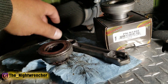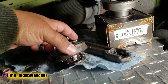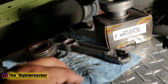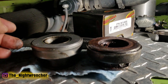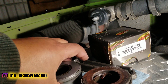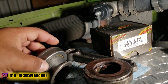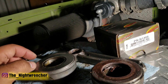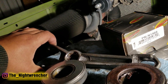One of the last things we're going to do is replace the throwout bearing. This is the one that came out of my truck — as you can see it doesn't really have any grease left in it and has seen better days. I've been driving on it pretty hard for the last five years. Center Force supplied me a brand new one to match my clutch kit. The new one is about a quarter inch taller, but I know how much slack I have for the shift fork so that's not a problem. I made sure the center bore was the same and that the shift fork fits inside the groove. I also went ahead and cleaned up my shift fork and greased the pivot.